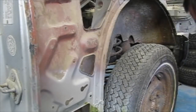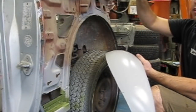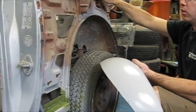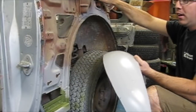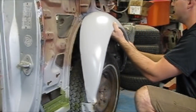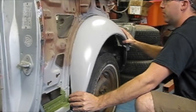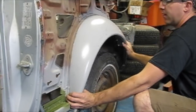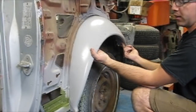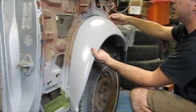We are still on the old camera. This is the next part I want to weld onto the car. I've got the door on the driver's side lined up. I've got the quarter panel lined up and I've removed it already. Now we're going to get this piece lined up and stack it into place — it's going to sit right about here. In here is where it's going to spot weld to the quarter panel, and then I'll do my seam weld here.